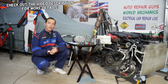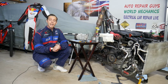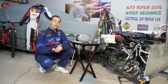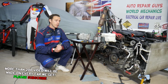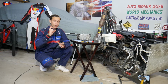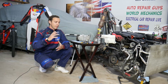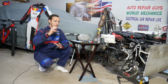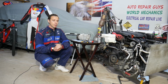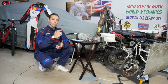Today will be a super helpful video for any of you having a Hyundai Santa Fe who needs to remove or replace the AC compressor control valve. If that valve does not work, your AC will not work, and that valve is super important. It actually activates your compressor because you don't have a clutch. This is the only thing that turns the compressor on and off, and it does it through a very complicated procedure so it can vary the pressure. That way you don't have engine jerk. At highway speeds it can reduce the pressure, so it can actually save on fuel as well.